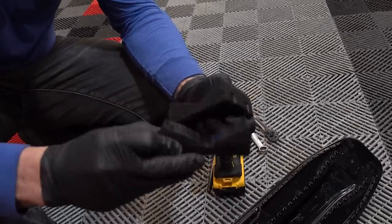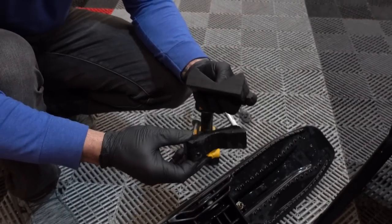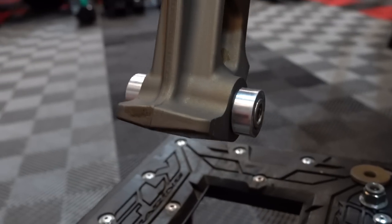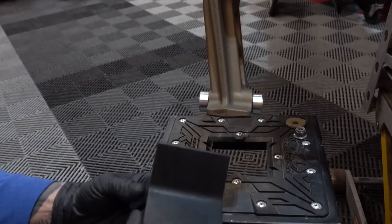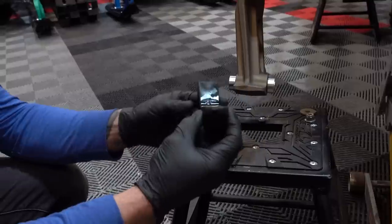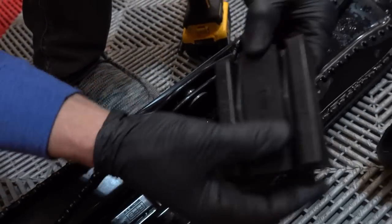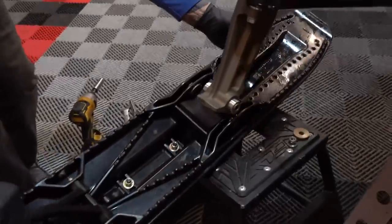Going ahead and swapping out to the new ski rubber so I can test these. You can see the amount of surface area on my spindle — I've got my bushings on either side and my ski stance is set up at that 36-inch center-to-center. When you make those swaps, the surface area of a wider ski rubber allows more purchase on there. With the factory one you're kind of half on or half off the spindle, and you'll see a lot more wear based on that. Got the new one from BWC Power Sports with directional arrows — it sits right down in there, fits really really good.